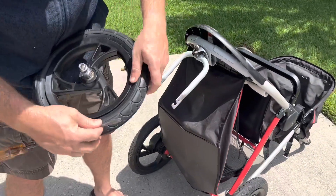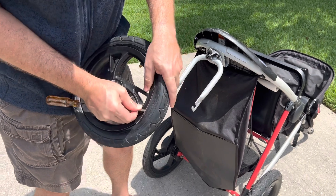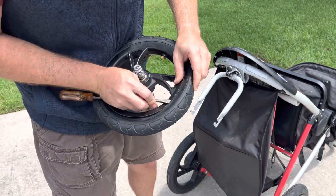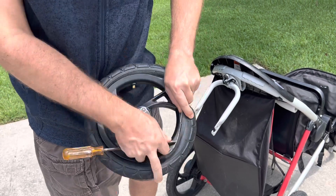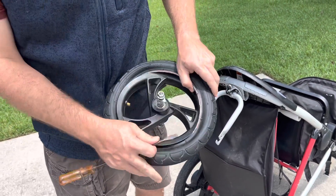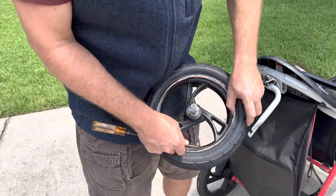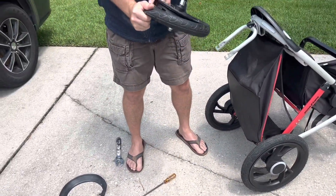This will definitely be easier if it's warm outside, but even if it's cool, it shouldn't be too tough. You can kind of work this around the edge and you'll get a grip on it and be able to get the whole thing up. You can use your fingers or your screwdriver — this is a flathead. Now we're popping that seat off for the seal. So we've done that much, and now we can pop the entire tire off.